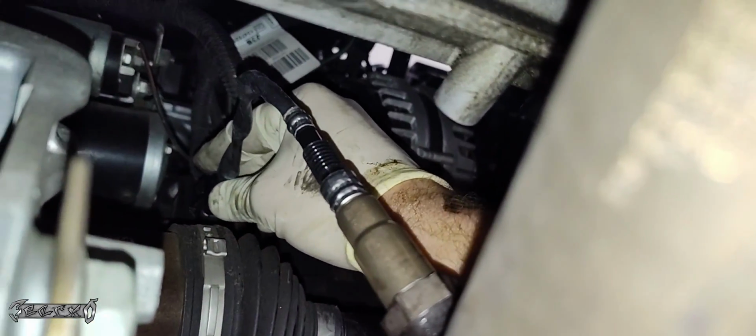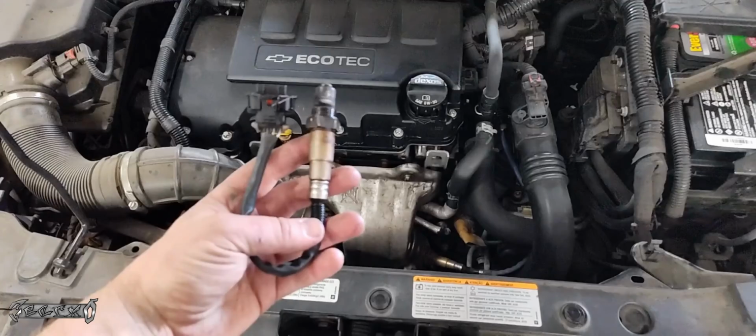So twist it in, and then I had to get the wrench to finish it off. I tightened it down. Snug plus a quarter turn. You don't got to go mega tight on these. Once you got it tight in, go ahead and reach up there and push your connector back in place. Just put it in as straight as possible, wiggle it, and then put it in straight. And that's it, guys. That's how you do the sensor. Thanks for watching, and I'll see you next video.